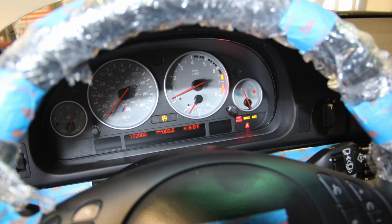So everything else seems to be fine. This engine spent about 30 minutes sitting at idle. It has a very smooth idle of 500 RPM. The engine has produced no check engine codes. The check engine light is not on. The DSC, brake and ABS lights are mysteriously on, reporting faults at both rear wheel speed sensors. We did put new bearings and hubs back there.